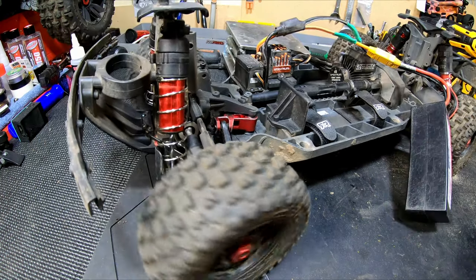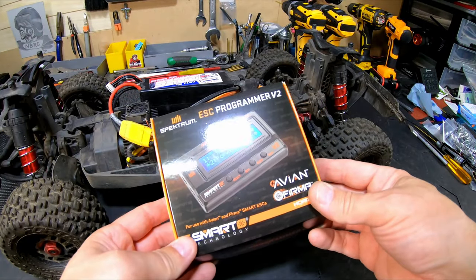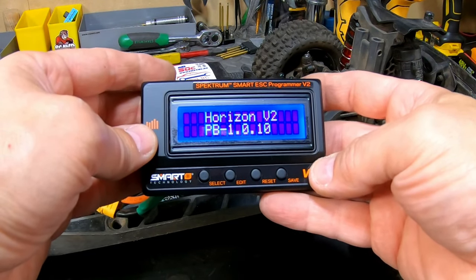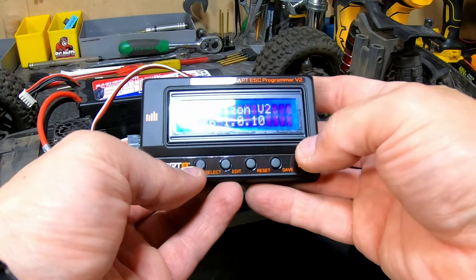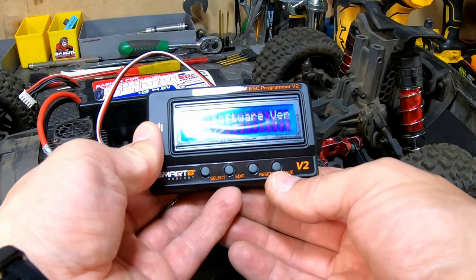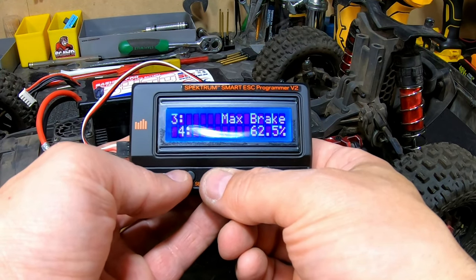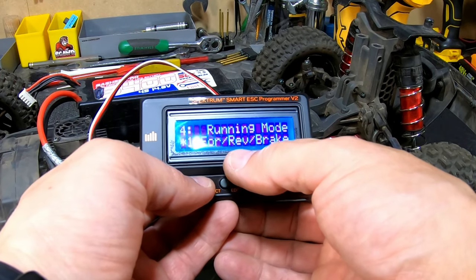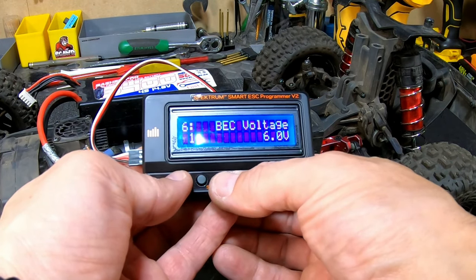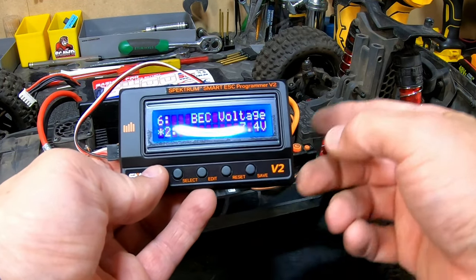That's off the ground and that's on the ground - steering is more direct now. We're going to use the programmer kit. Get the fan out - look where the minus is. It's version 2, you don't have to upgrade it. Connecting ESC - punch level 5, 50 is standard, I'm going to up it a little bit. Running mode forward/reverse brake, motor rotate is okay. BEC voltage is 6 volt - we're going to change that to 7.4, then push save. Now we have 7.4 volt on the servo.